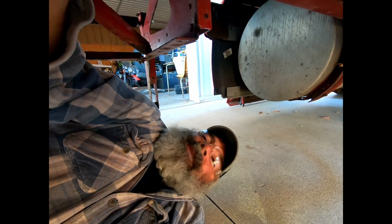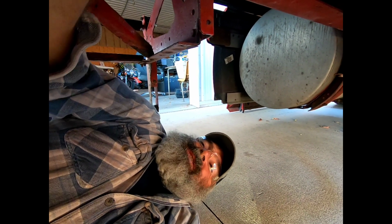So I was thinking I might try it first, find a socket that fits on there and hit it with a hammer and try and drive it down through and then just bust it off as it comes out the bottom like I did the bottom part of it. Or take my jigsaw and get up in there and cut it in a few different places. Cut that plastic and maybe it'll fall out. I think I'll try the socket first just to see if it moves. If not, we'll get the jigsaw out.